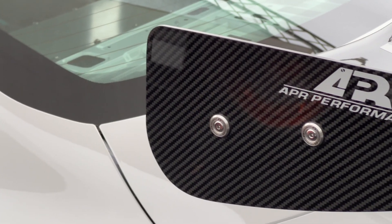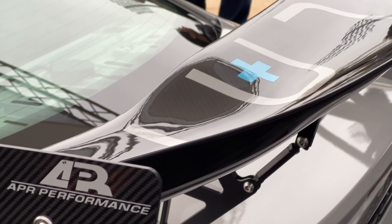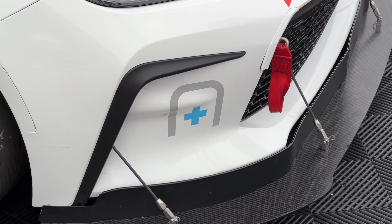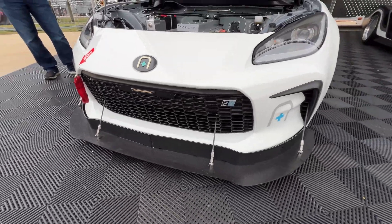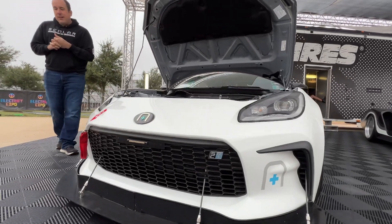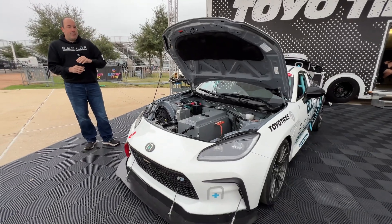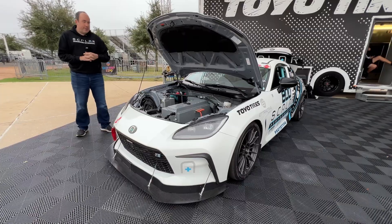APR's wing is amazing — funny company name but those guys are professional and awesome and really helped with the aerodynamics. The splitter on this car comes on and off really quickly — the carbon rods flex up if you go a little off-road, and titanium sliders run over the curbing well. They create a lot of nice hardware, and with just one little wrench you can quickly adjust the splitter. This car has been to the wind tunnel — you can see their wind tunnel video on our YouTube. Everything is so adjustable on this car.